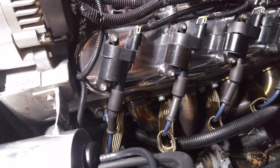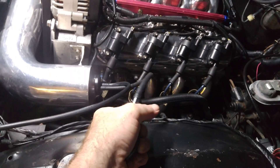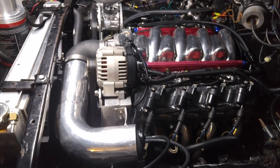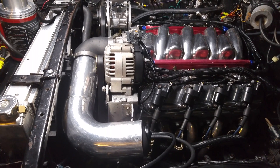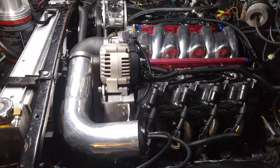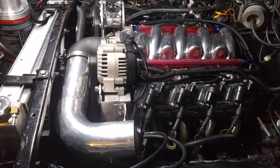This is an inflatable bladder system. What it allows me to do is take off the air filter, stuff the bladder into the inlet tube, and pump it up like a blood pressure cuff until it seals. Once sealed, no smoke comes out the back, and it smokes into the intake manifold. It'll take a few minutes to fill because it's a low-output machine — only about one PSI — so it takes a minute.